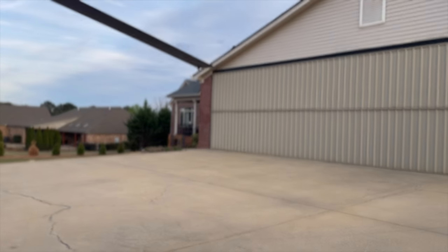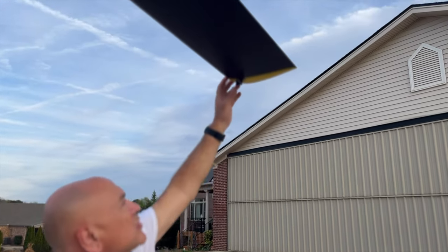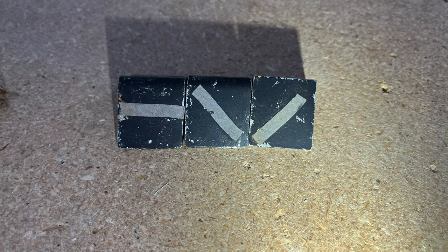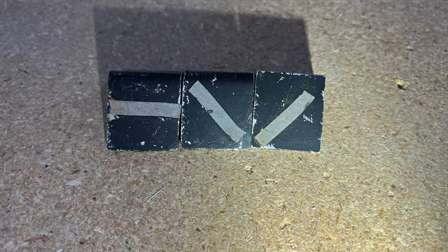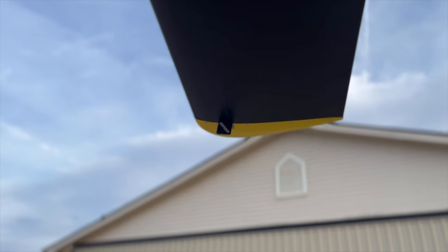And if you walk out here to one of the blades, go to your right over here, you can see we put on reflective strips on each blade. So see, this one is tilted to the left. One other blade is tilted to the right and another one is straight. And what we do is adjust those pitch control links so that they're all in the same plane. And we got them pretty good today in the hover. I was flying around 85 knots, so a little bit of a shake there. So now it's a compromise.